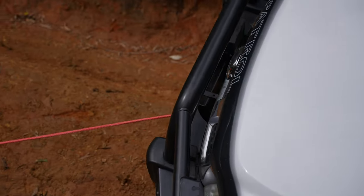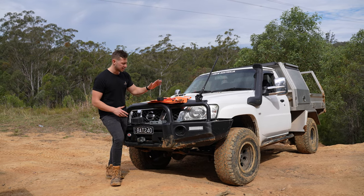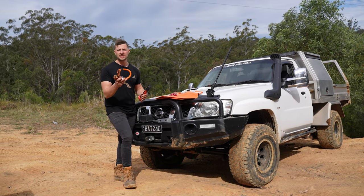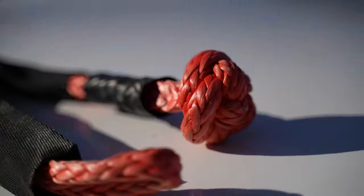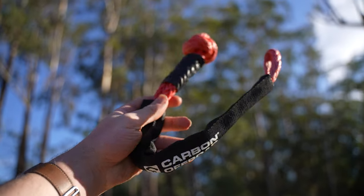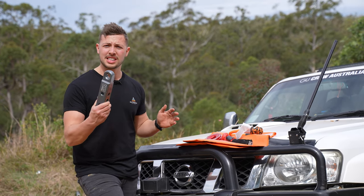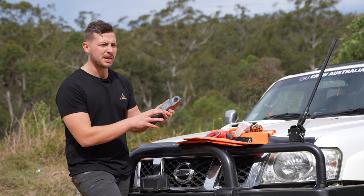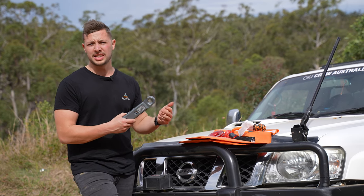We're in the midst of it now. We've had to use the winch a few times today, and I wanted to show you some of the gear that's been helping us get through the tracks. From Carbon, obviously we've got the winch up front, but some of the other bits of gear we've used today are their soft shackles — the monkey fist soft shackle with the braided sheath over the top, super good for rougher stuff, you're not going to damage it. We've also got one of the Carbon off-road soft shackles with the protective sheath. For one of the recoveries earlier, we used one of the hitch blocks — it's multi-purpose, works on any hitch style, can be mounted horizontally or vertically, and it can receive soft shackles or traditional D shackles.